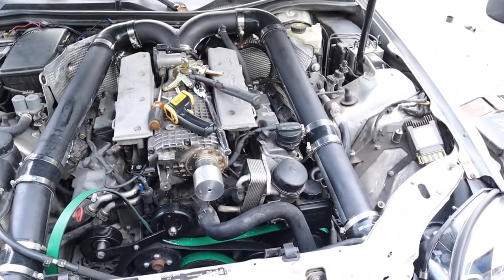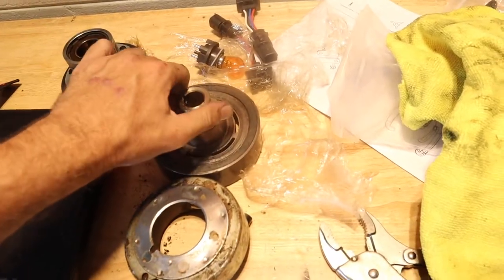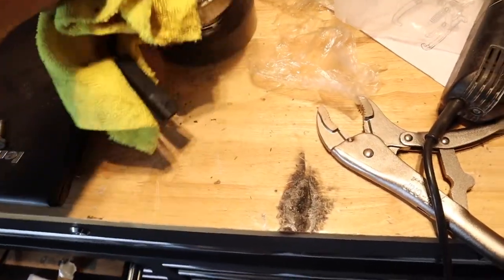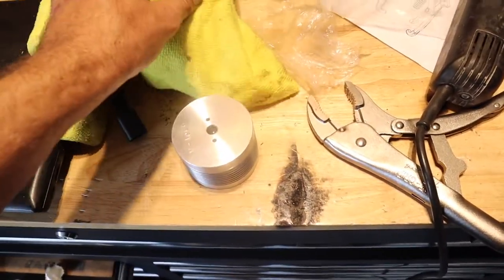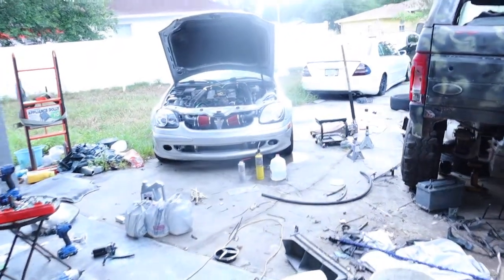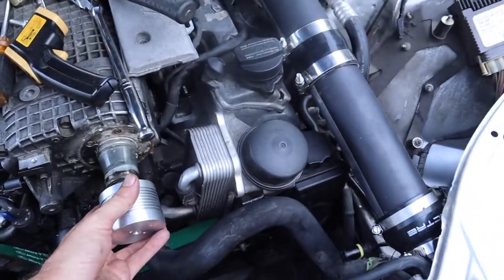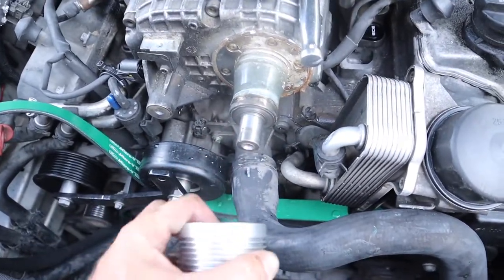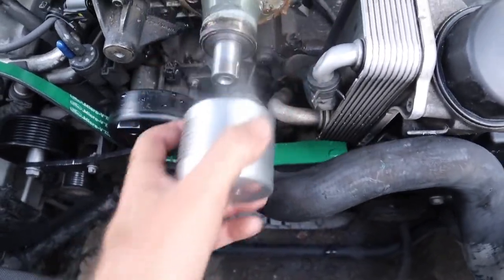That looks so much cleaner. I built up the pulley — it's really not that hard to do. The little dowels go right in there, you just tap them on with a rubber mallet and they go right in. Then I put the washer on. I'll probably end up cleaning up the washer too, make it look shiny. I'm just taking a little polishing cookie to clean it up and make it look kind of nice. Good mating surface and all that. Could have spent another 30 or 40 minutes just polishing everything, but it's not bad for a quick job. Even just with the dowel pins, it holds it pretty good. I'm going to give it a little tap to make sure it's all the way in — it felt like it went in pretty much all the way with no heat.